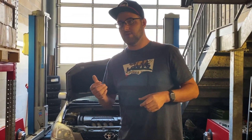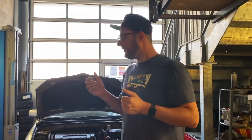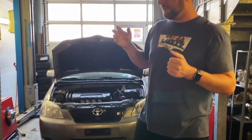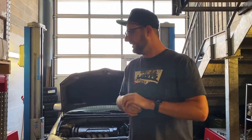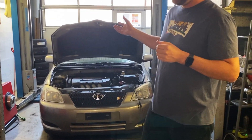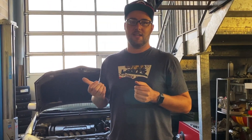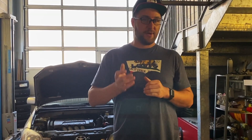The video today is not only about showing what the 2ZZ does from a performance perspective, but also about understanding how to correctly put a car on a Dynapack dyno, calibrate the gearbox and engine, and just have some fun. It also makes sense to do this because if I take the engine out without knowing its stock power output, it can be a bit confusing.